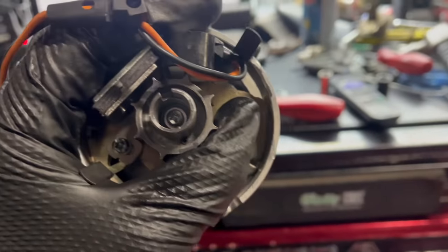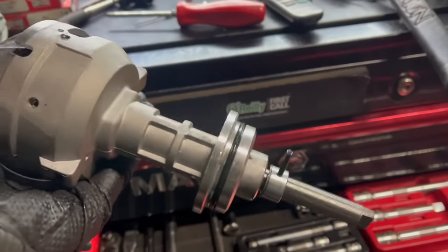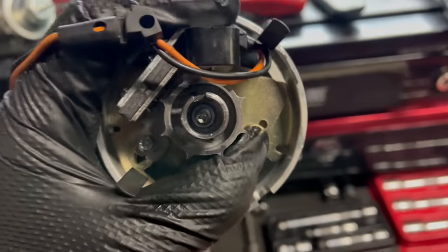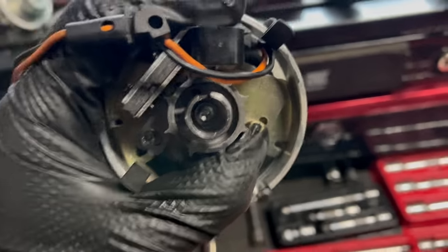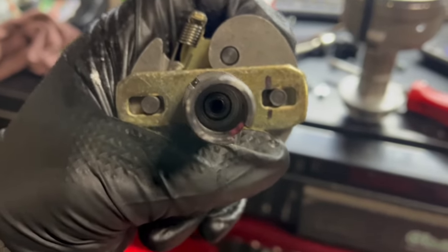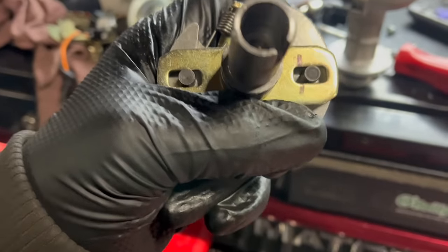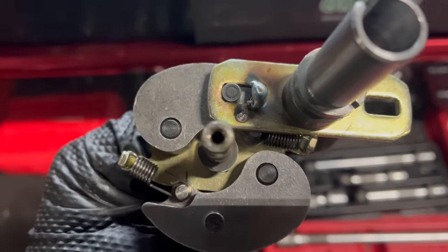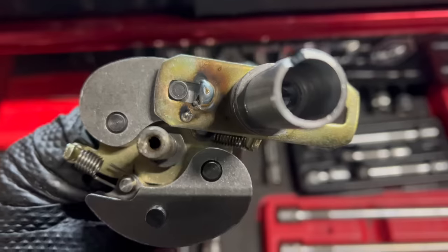I've done a whole video about welding up the slots in your distributor to change your curve. I'm breaking this distributor down — this aftermarket dealey-bob which came from HiRev with their box has a screw holding the top section in. Well that's cool except the screw was loose. Normally there's a really annoying clip in here, so I do like this better. Here's the advance mechanism — you can see the slots there. I want to eliminate about half of this travel. I mapped this distributor out and it had 20 degrees of advance. I drew a line — if I ended up with a 10 to 12 degree curve I'll be happy. Compare the size of that slot to that slot: the pin fits in that slot twice, and fits in that one about one and a half times. So we should be really close. Also for science I removed the heavy spring and put in a super light one — it should do more advancing faster.